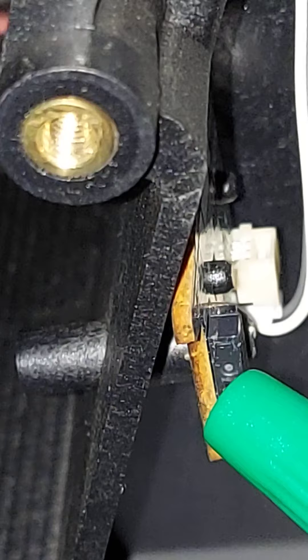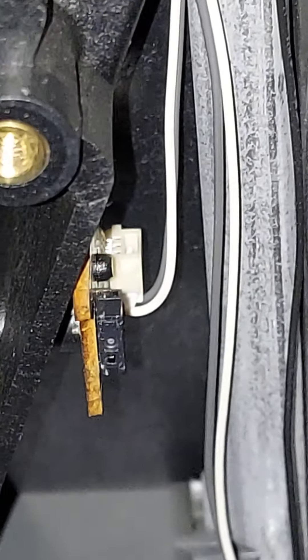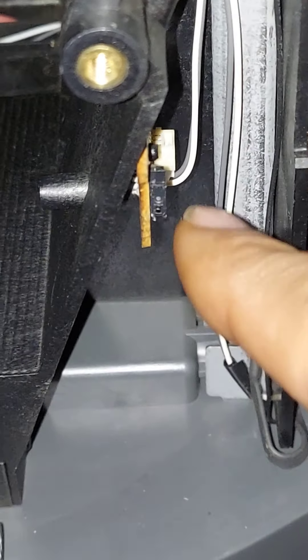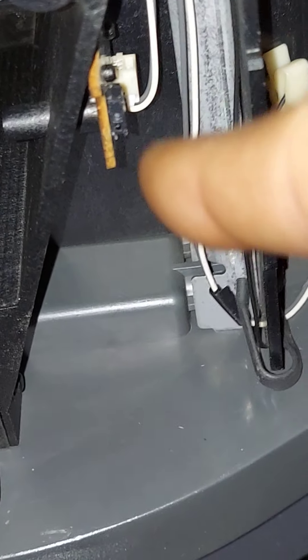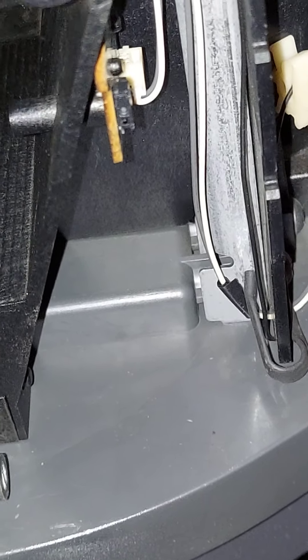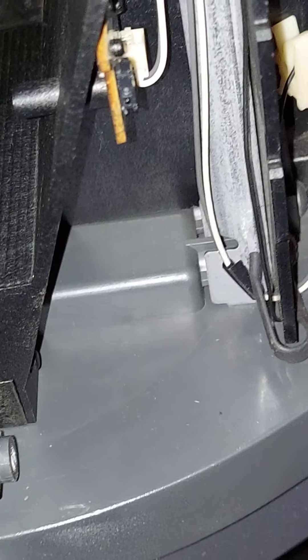That little black button, and most likely that white tab right above it is also some type of feel-type sensor. The pin that was attached presses it — you hit the button and it covers the little white tab above it. But if you don't see a metal pin there, or if it's hanging off, most likely that's the reason why the television itself is not coming back on, because three blinking lights nine times out of ten is going to be a sensor issue.